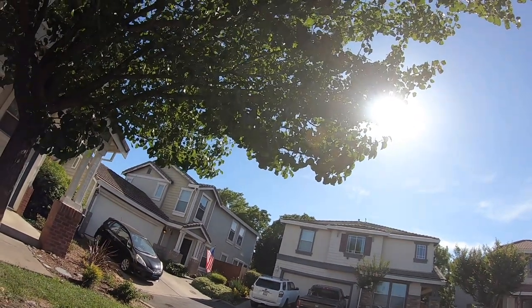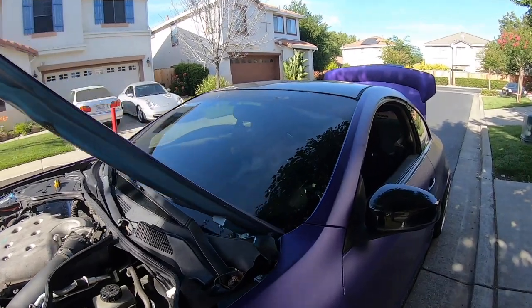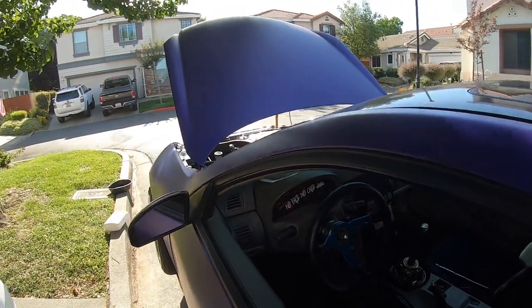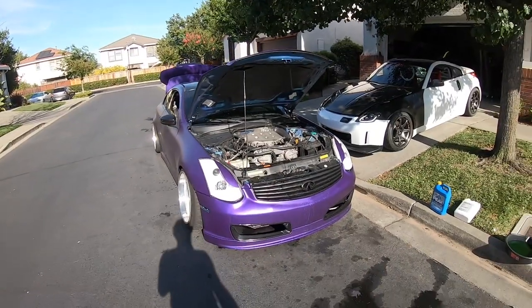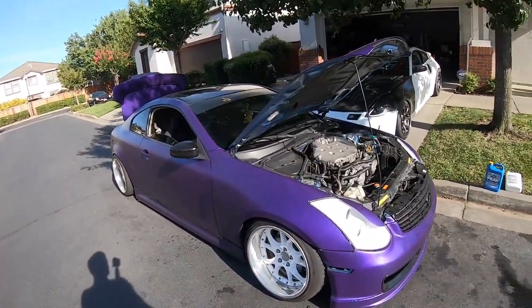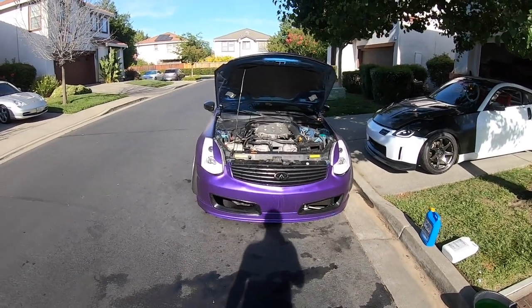Burping coolant in 100-degree weather is not fun — you can see how beaming that sun is. I think it's about good to go. I was holding the gas at about 3K RPMs and there was no overheating, no more bubbles coming out, so I think we're good. Cars back on the floor — wasn't too bad of a burping process, probably took about 30 to 45 minutes. I checked underneath for any leaks and there are no leaks from the oil cooler at all — everything looks good. Thanks so much for watching guys, hope you enjoyed the video. Leave a like, leave a comment, subscribe if you're new, and until the next video — peace out!